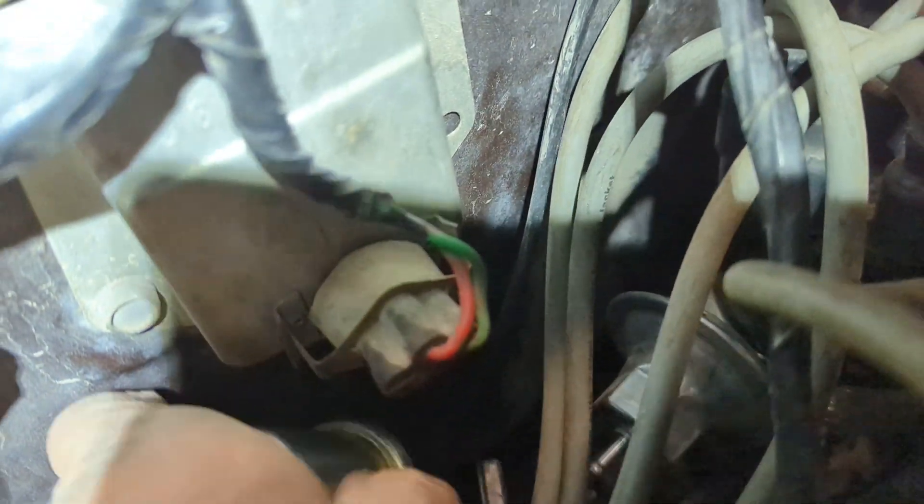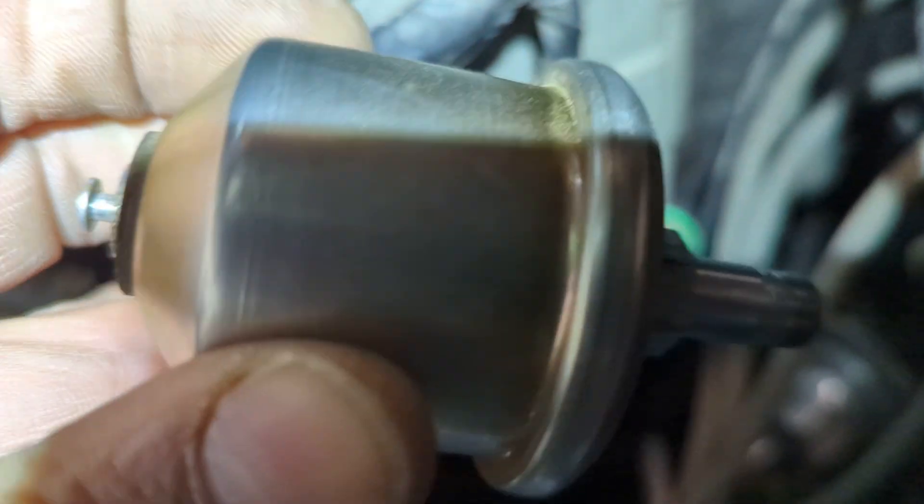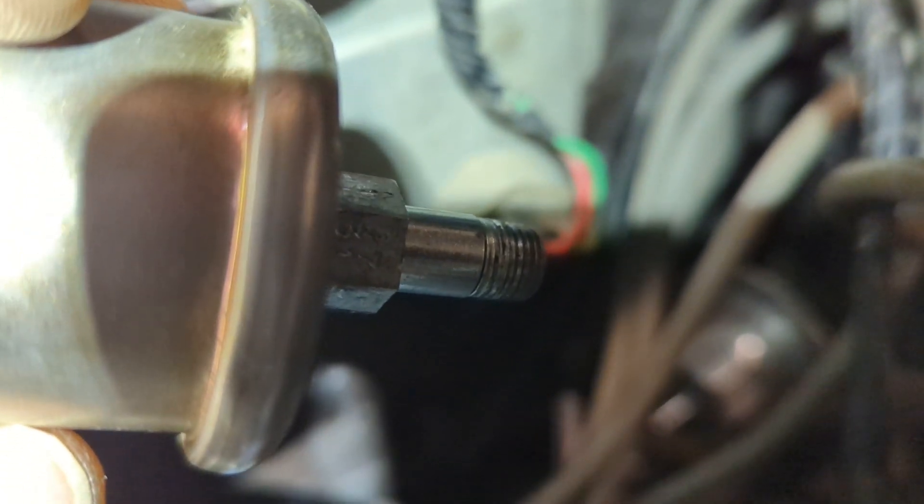The quickest, easiest way to add another port: the LA 318 actually has two ports. It has the big sender, and they sell some different ones that are a little bit smaller for the mechanical gauge. There's also an idiot light in this vehicle, but I wanted to leave all that alone, keep it factory, and add another gauge.